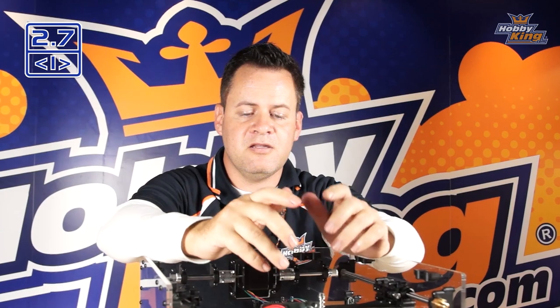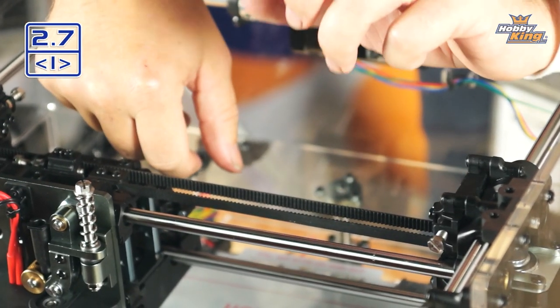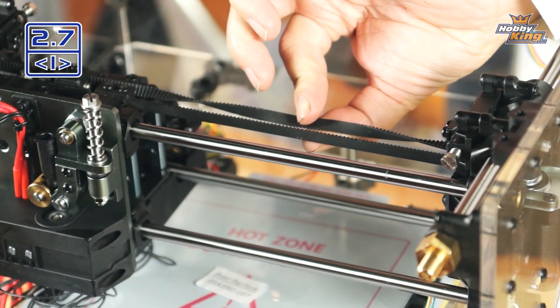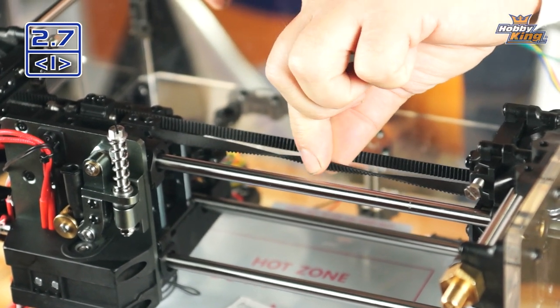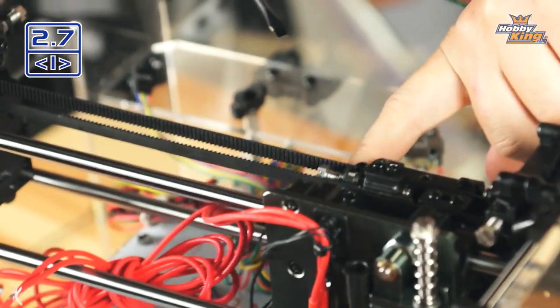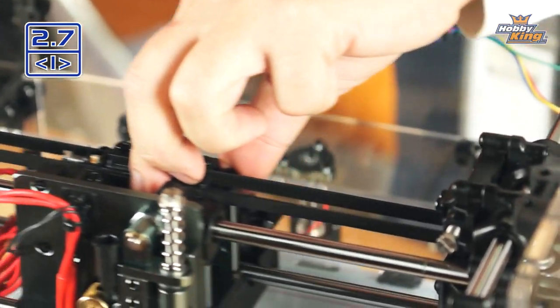It's difficult to explain exactly how much tension should be on the belt. In industrial situations there's a tool that squeezes the belt and measures tension, but on these smaller timing belts you do it by feel. The easiest method is the 90-degree twist — slide over to access the belt, grab it, and rotate it. Each full twist shortens the belt's effective length and tightens it. What we're looking for is about 90 degrees of rotation before you feel significant drag. Use a flat blade screwdriver on the adjustment screw — give it a half turn, slide over, and try again.